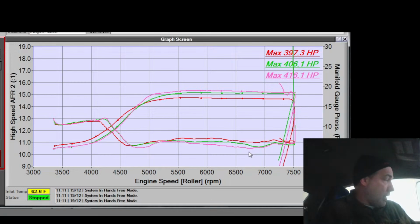But, you know, you're looking at so little benefit to go in that high. In freezing temperatures, your air temp is going to be cold. Your fuel temp's going to be low. It's sitting in a tank, it's getting icy cold. Like E30, E40, you're going to get way better fuel economy and almost as much power. You don't need as much of the cooling that you would need in the summer with full ethanol. E40 is great. It's awesome.